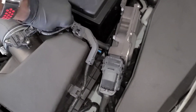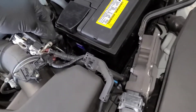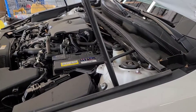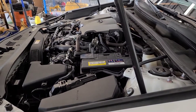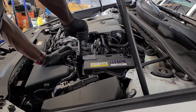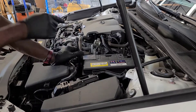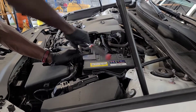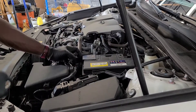Now install the battery holder nut — get the hook like this and install it down there. Use your 12 millimeter with an extension. Links will be in the description for the tools and battery. Make sure you put this in before you put on the terminals. Tighten everything up — there we go, everything's good.